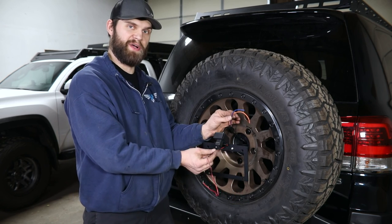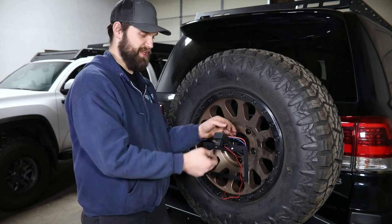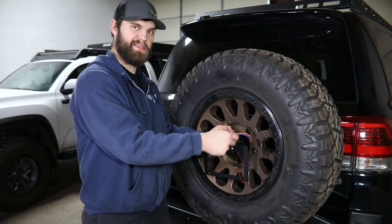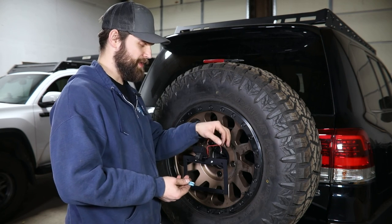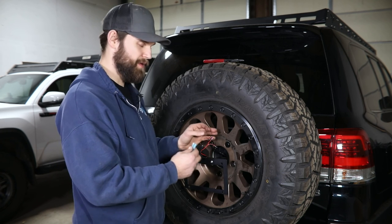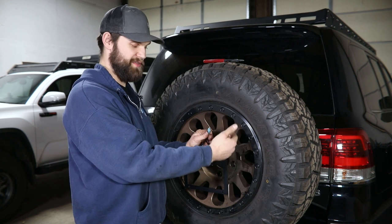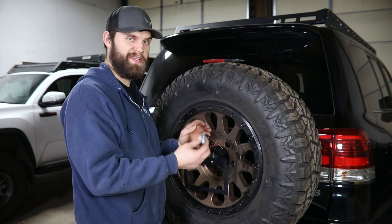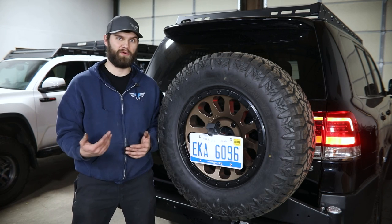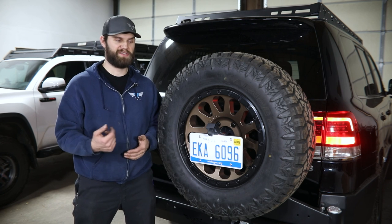Now that you have all that in place, cut these wires to length and install the provided heat shrink spade terminals. You have a decent amount of excess wire, so cut these fairly short so that you can plug the spades in behind the camera and tidy this all up with a little bit more loom or electrical tape. When hooking these up, note that the red is going to be for the power coming in on the light, so connect the corresponding wires appropriately. One thing you can do to make sure these don't get hooked up backwards is use a female and a male connection on each end so they're the opposite on the light side. Crimp these in place and heat shrink them down before plugging them in. Now throw your license plate on using four more quarter-inch button head bolts.